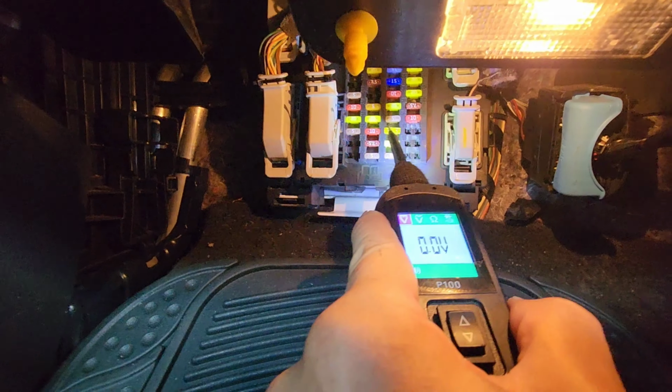So we can go into the system settings. In fact, car settings. So go into the factory settings here. Usually 8888 is the code. Then you go into the CAN bus settings. So from here, you gotta choose which car you have. This is Ford Focus. What's that? Update. No network. So we're gonna have to connect the Wi-Fi in order to update the CAN bus.